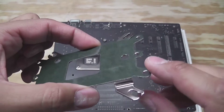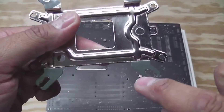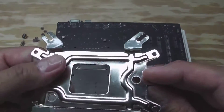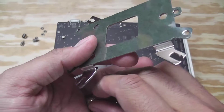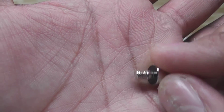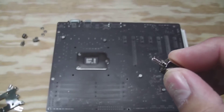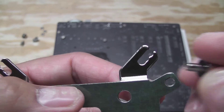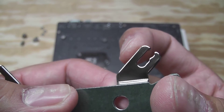Here's the backplate. You'll notice there's a pad on the back and on each of the legs. Depending on whether you have AMD or Intel, the orientation differs — for our purposes this side faces down on the motherboard. For the posts that screw in from the top, there's a flat side on the post. When you install the post, make sure that flat side corresponds to the flat side on the backplate — the notches are rounded, so make sure the flat part is aligned so it sits right.